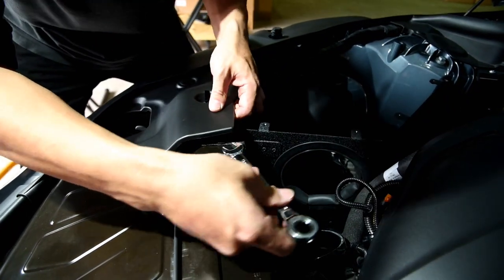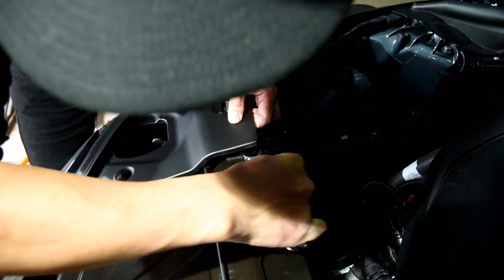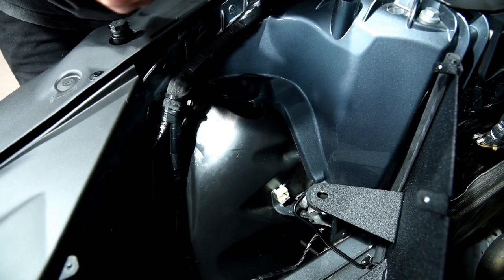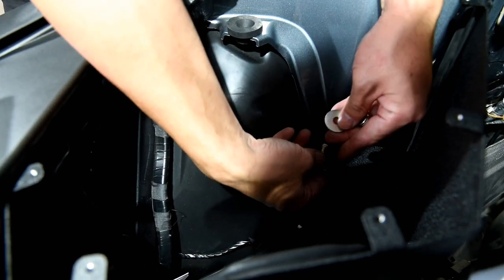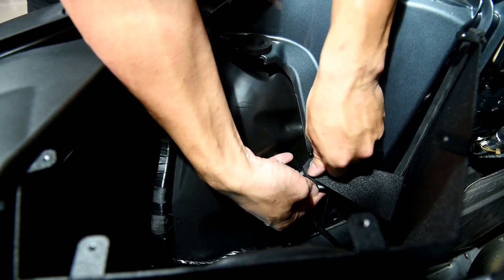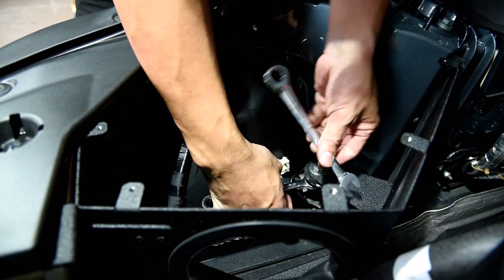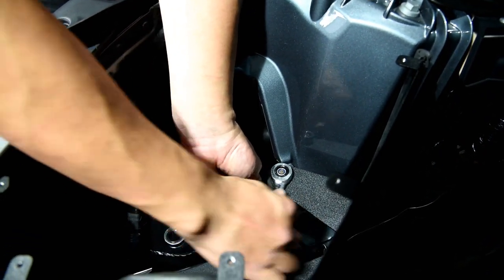And now that the heat shield's in place, we're gonna tighten it down. Okay. And then we tighten the inside bracket. So we're going to be using the washer for that, like so. Put the washer in, screw in the bolt, then we're going to use 2 wrenches this time. So one to hold it in place and the other to tighten, clip type, like so.